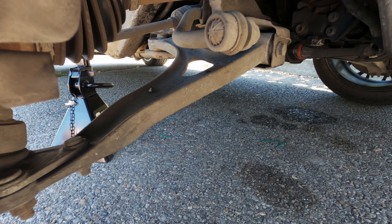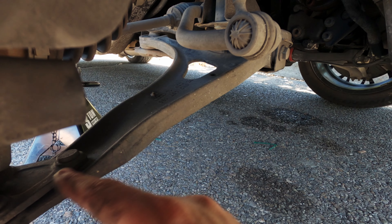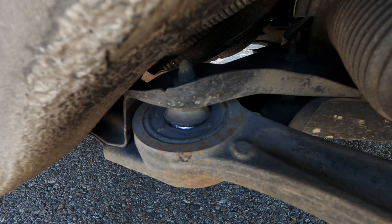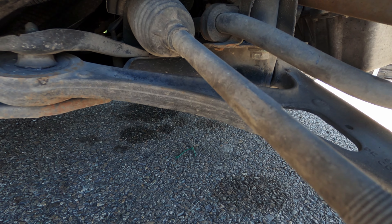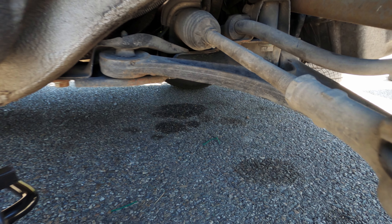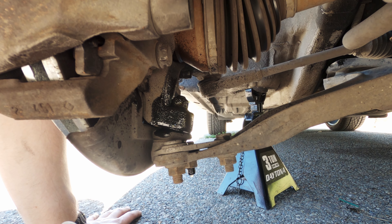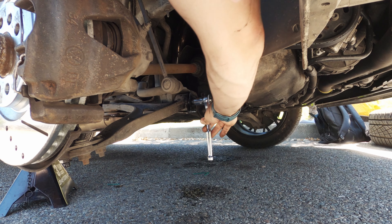This three-pronged piece of metal is what we're replacing — it's our control arm. This front one has two connections to the subframe and one to the ball joint. This crack in the bushing here is literally what inspired me to redo the whole suspension, which I think is kind of funny. German suspension bushings are designed to be biodegradable, so these don't always fail because of overuse — sometimes they literally just fall apart from old age, and that's by design.